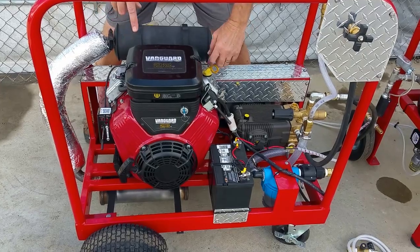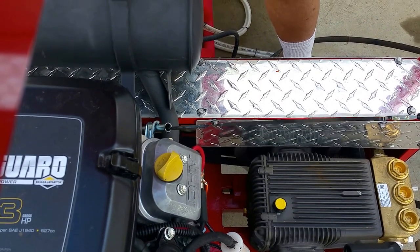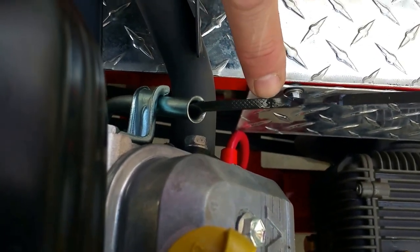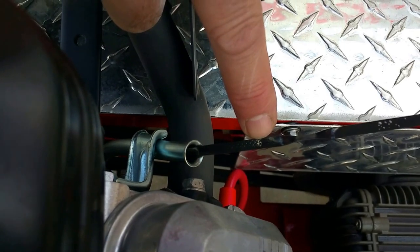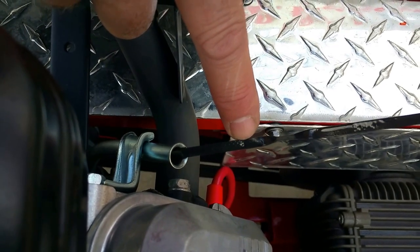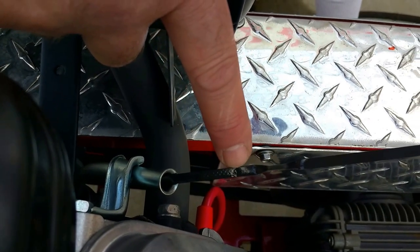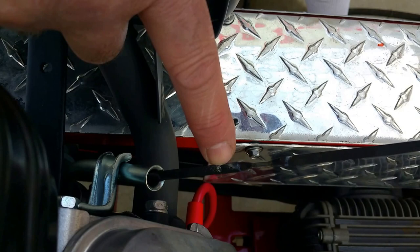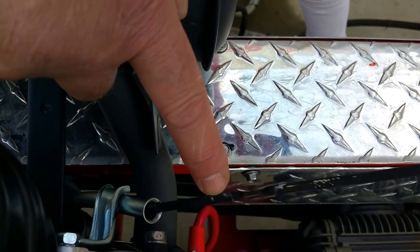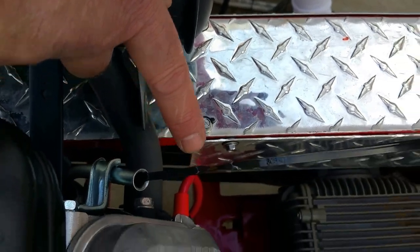Take care of your machine. The dipstick is here, and the notch on it has hash marks to show you the full level mark — right there is the top of the hash marks, and that's where you want to keep the oil. Consider the bottom of the marks the low level, not the high level; we always want to see it at the high level. For every six ounces the engine is low on oil, it's probably running 10 to 15 degrees hotter. Be nice to it, take care of it, and you'll enjoy long-term low cost and reliability.